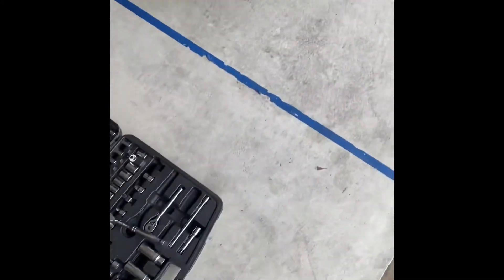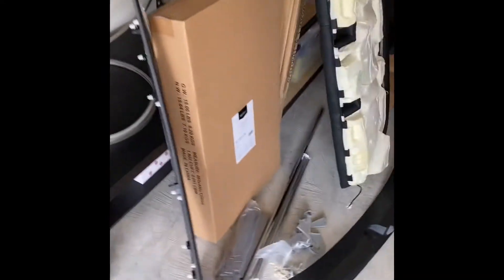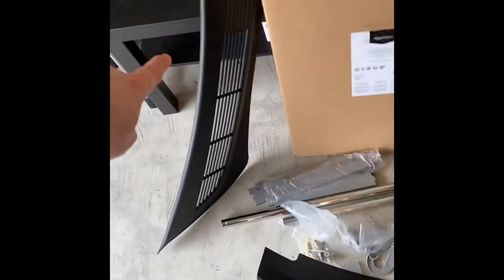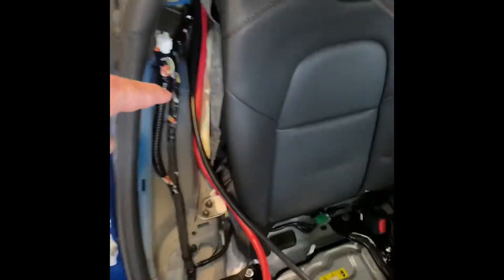Here's what it looks like so far. You can see some of my tools, and since I'm going through it first you want to take off this panel here and disconnect the 12-volt negative terminal. You can see some of the paneling — this is the bottom seat, the trim for the battery in the front, the trim for the trunk, and this side panel goes right here. You can see where I'm running all of these cables.